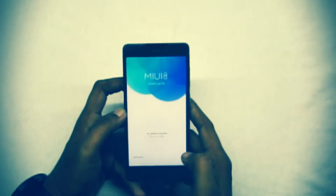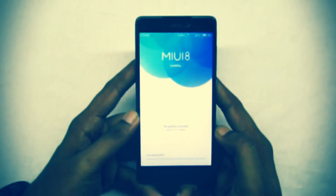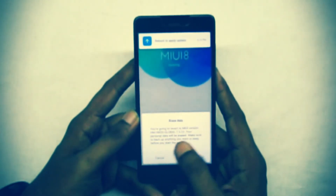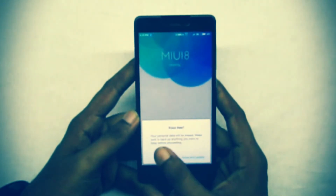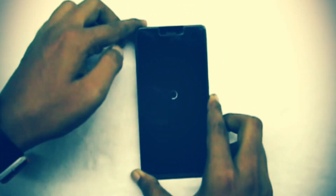Press OK. It's now decrypting the file and it will take around 5 to 10 minutes, so I've cut the process. Now it's ready to flash and it says it will erase all the data on your device. Before doing this step, take a backup of your data. Click 'Erase and Flash.' This process will take a lot more time so I'm fast forwarding it.